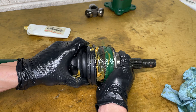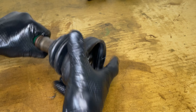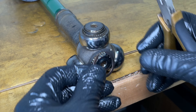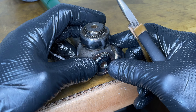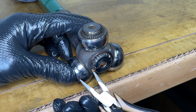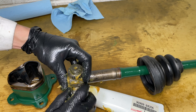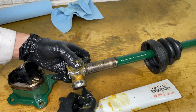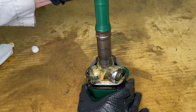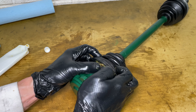I'm using my fingers to force as much grease as possible into the bearings — I want to completely fill this part. The grease doesn't all fit into the cup, so the rest will go into the boot. I'm trying to get every last drop of grease out of this tube — the more grease, the better. Now let's close it up. Work the CV boot over the large end first — it will snap into place. Then just push the smaller end until it snaps into place too. The inner CV joint has this triangle shape — install it onto the shaft. Now the bearings go on and make sure to line up your marks. Now I can push the boot down and make sure both ends snap into their grooves. The inner CV joint can move in and out to compensate for suspension movement.